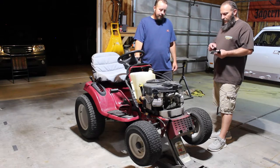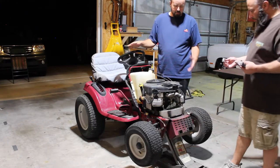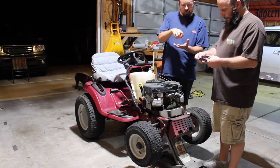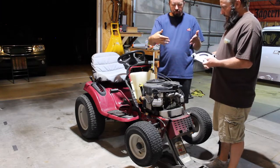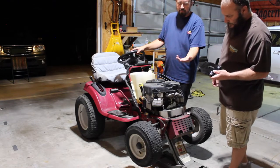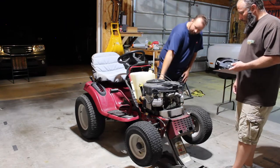Today we're looking to replace the tie rods that are shot on both sides because I just let them run for so long with the bad steering gear. The steering gear will wiggle down around the base. So when you go forward and back, it pigeon toes those wheels, and I did that long enough that it snapped the tie rod. And of course, I already replaced the tie rod for $12 and snapped another one. So we're getting to the real problem, which is through the steering wheel underneath.